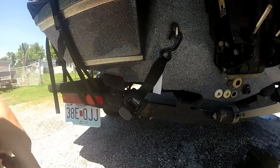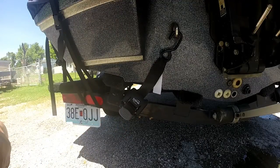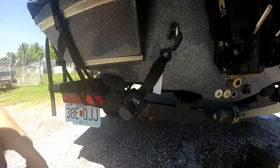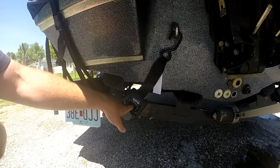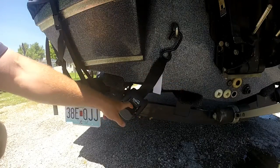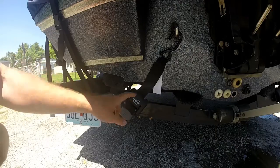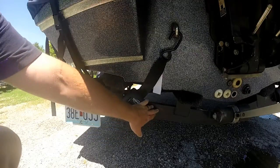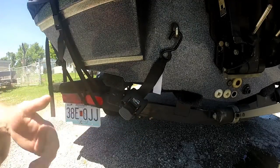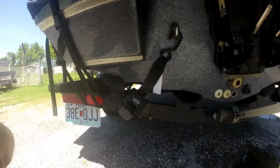That's when I decided to go out and buy some boat buckles. I had to drill some holes and had some problems — the first drill bit I had was a half inch bit. I had no problems getting through one side, but the other side the bit got dull on me. I went to the local hardware store and picked up a DeWalt titanium drill bit made for going through steel. That bit was a lot taller than the one I had, but I worked with it and finally broke through and got the buckle put on the other side.